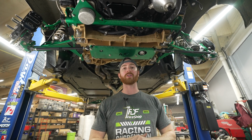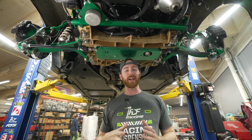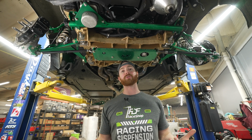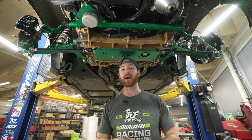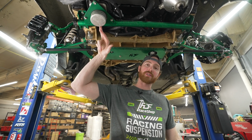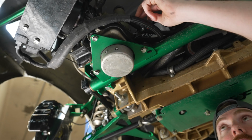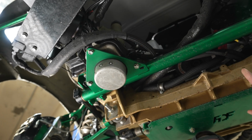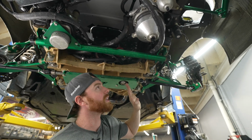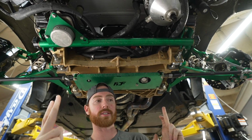It's a pretty neutral steering ratio, and you really don't need to go for the M rack that has a different ratio, because in drifting, the kit was designed around having a pretty neutral ratio as far as the steering rack goes. So you don't need to go crazy on the racks. We use a Volvo steering pump, which is an electric hydraulic pump, and we keep the pressure line as short as possible. So the pump is here, and then the line, I believe it's 22 inches long, goes into the rack there. So the line is about this long.